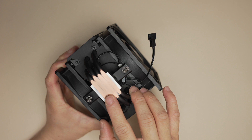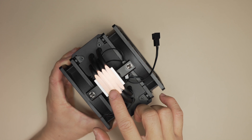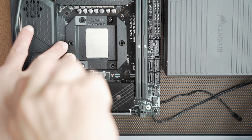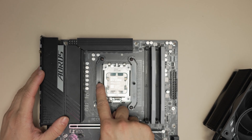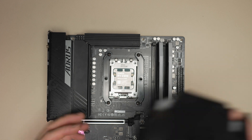Curiously, and they've done this with very little negative impact on some of their other coolers, the contact patch here is quite small and only covers a portion of the AM4 IHS. It's even smaller than the AM5 IHS, and would only cover the center of the rectangular LGA 1700 IHS. Like the Liquid Freezer 3, there isn't any more support for older Intel sockets — just LGA 1700 and the upcoming LGA 1851. Those mount similarly to the LF3, where you remove the retention mechanism for the CPU and attach the included retention frame. For AM4 and AM5, non-offset mounting bars line up to the center of the IHS, replacing the stock motherboard cooler mounts.